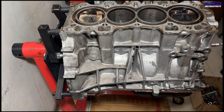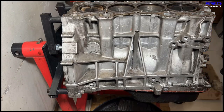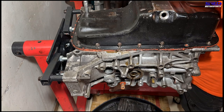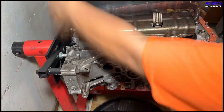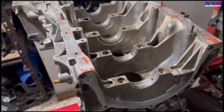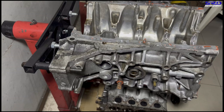My colleague is disassembling the block. The honing marks are pretty good, but the carbon buildup is thick on the domes of the pistons all the way up to the top ring level — so this has been running rich or not tuned well. You can see the owner bought this locally and it's already been rebuilt, because of the red silicone sealant — we don't use that. But props to the previous owner, because it's pretty clean with good oil change history.